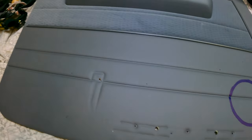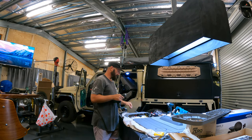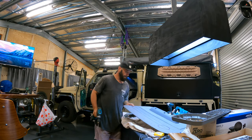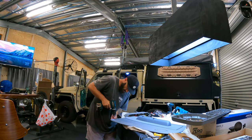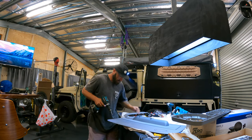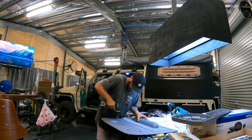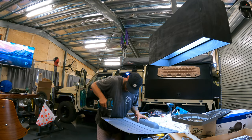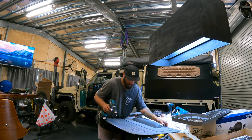As I was saying, marked all the holes. Alrighty. So next stage, 3.5mm drill bit, and we'll drill these out. Right on. Still got my 3.5mm drill bit in. Drill these out without going through my pull table. Make sure you get them right on the mark.